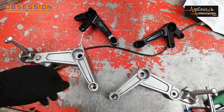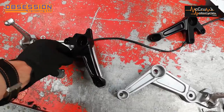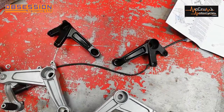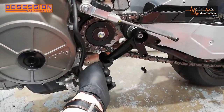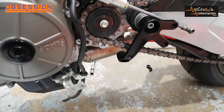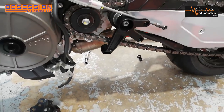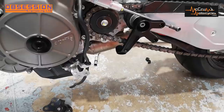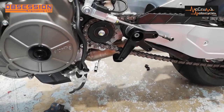Down on the bench I've got the old foot rest assembly and the new one comes in two bits: the part that replaces the swinging arm pivot attachment to the engine, and the actual bit that holds the foot rest. The gear change side rear set plate is meant to fit here, but it's designed to also fit with the side stand pivot in the way — that's 10mm thick, made of steel, and I don't want the side stand pivot. I find it a little strange that they've sold a for-race-use-only rear set where you still have to leave the side stand on it. So I've nipped into the machine shop and made a 10mm spacer to replace it.